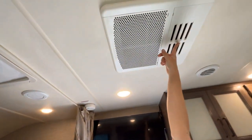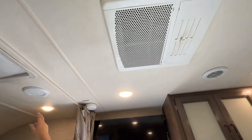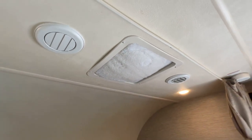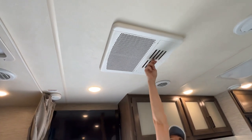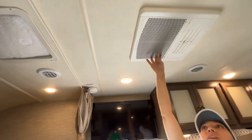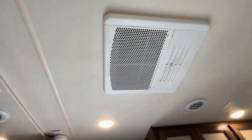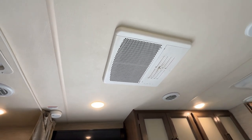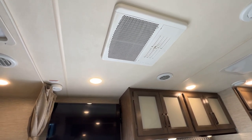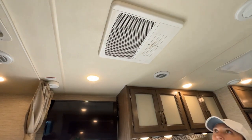For the strongest flow, leave this main vent open. If you want the flow to come out of the side holes — maybe you want to push it towards this person or towards the master bedroom — you're going to want to close off this main dump. Cooling it down the fastest. You also have one filter here. If you're going to be in this RV for over a week, please make sure that you push this cover off, wash off the filters, pat them dry, and stick them back in. If you go to places like Big Bend or Grand Canyon — somewhere that has a lot of dust — this will stop the compressor and have it not cooling as much. So we want to produce as much airflow as possible into the AC.